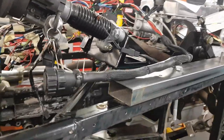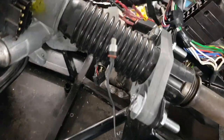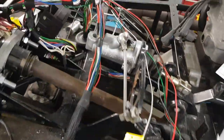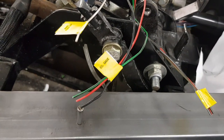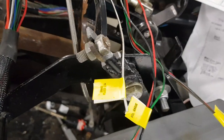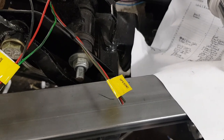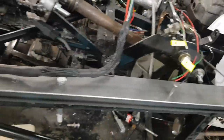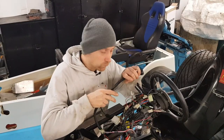And check it out - all wrapped up, all in its braid, all heat shrinked up. Got the connector that goes to the back of the clocks, and we've got the little wire that comes to the switch to change the settings on the dash, and it goes into the rest of the loom. I did add some ignition live, illumination and earth for the oil gauge - they come off the clock so they've got the same feed and they'll be on the same fuse. We've got the brake fluid low that goes to the top of the master cylinder, and the speedo that goes to the back. I think this looks pretty awesome. So that's all the wiring for the clocks all in.